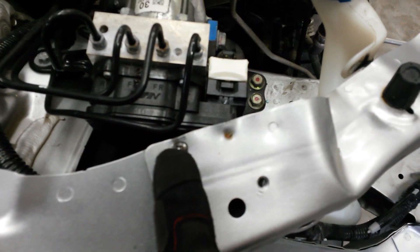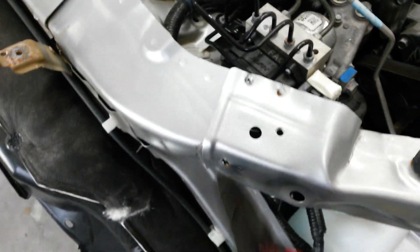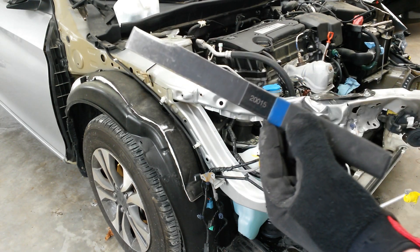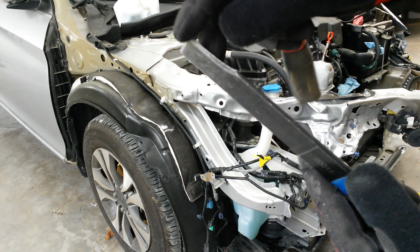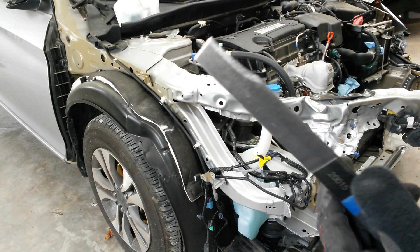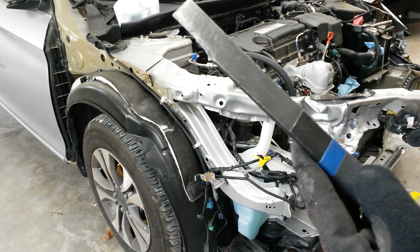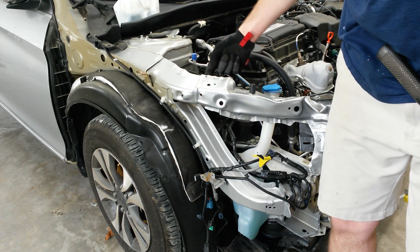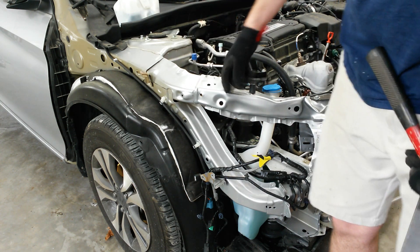Over here I already drilled a couple of spot welds — that one was pulled off already. I'm going to get my seam buster and just knock this through. Here's the seam buster if you've never seen one — part number 20015, I got this from Steck. It's sharpened on one end like a chisel and sharpened on the side. I'm going to try to protect all the original apron here, so I'm going to insert it on this side and go that way for this spot weld, then insert it on the corner and come back this way so I don't scratch this.